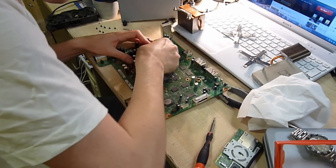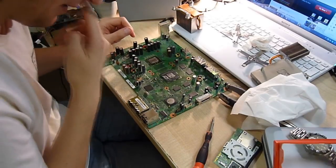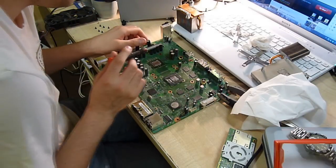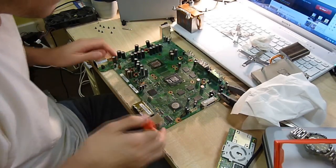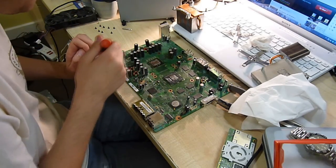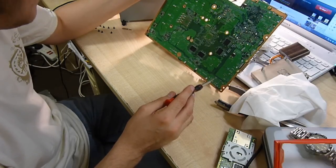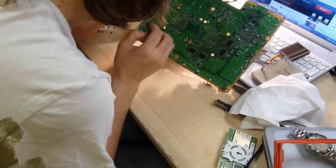I wish I had alcohol spray but I don't. Anyway, in a teardown people generally want to know what everything is. Here you've got your GPU set with all this GPU goodness - it has two chips. And your CPU, which if I remember correctly is some form of tri-core. The RAM goes along the bottom as well - a total of 512MB if I remember correctly. This section is pretty much a power supply area, taking power off the board, filled with MOSFETs, inductors, and chokes.